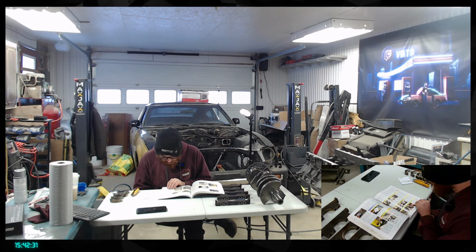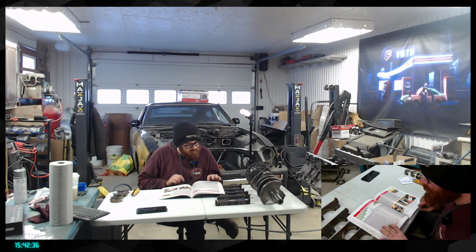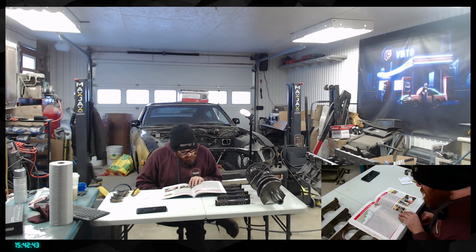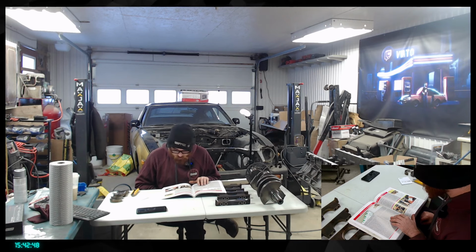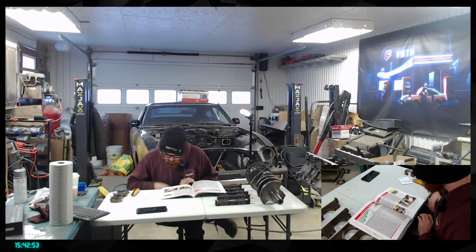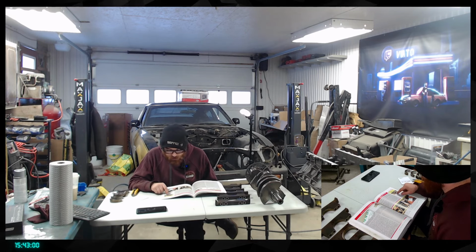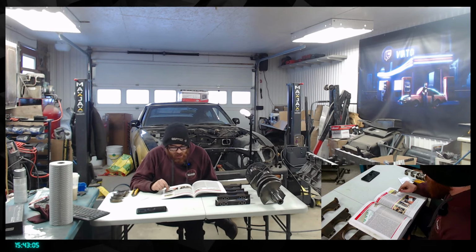Lay a piece of plastic gauge on top of each main bearing journal once the crank is in. Bearing clearance measurement. So there's a bunch of things here. I'm going to have to look at that. See step 8 for the torque sequence. So step 8, but what is the order? All right, so I'm going to have to go to chapter 8 because they already covered the torque sequence. So basically I'm going to be going around that and using it.